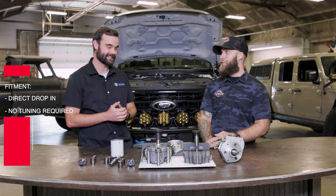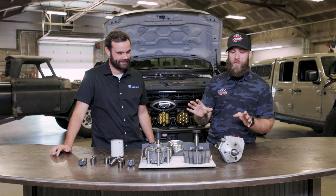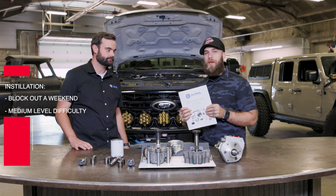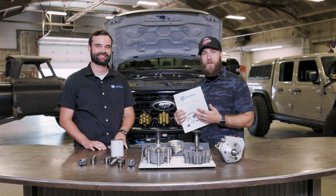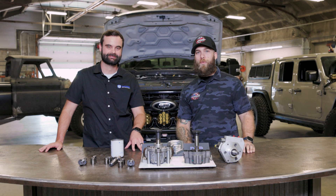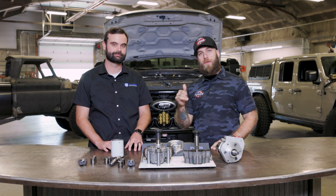But yes — roughly 25% more displacement than what you'd find in your factory CP4, and there's no replacement for displacement. If you're looking to install one of these DCR conversions, make sure you block out a weekend. It's about a medium level project. They've got great color instructions — make sure you read them. They include a list of all the tools needed, so make sure you look at that first and go to the tool store before you dive in. This project is going to entail taking your intakes off, taking your fan off, and then the vacuum pump on the front — and then it'll have the nut for the CP4 right there.